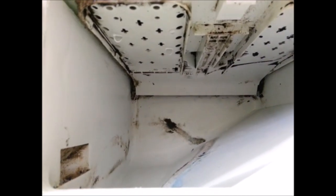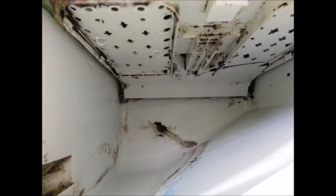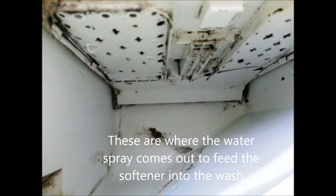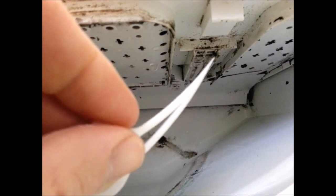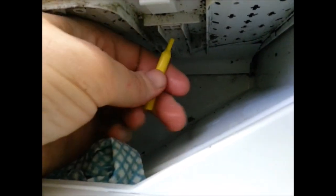I've taken the tray out and you can see there's black gunk everywhere, which is caused by putting too much softener in — it can go a bit mouldy. I need to clean that tray, but the main problem area is these four holes in the middle up here. That's where the softener comes out. I'm using the flossing brush to clean them out — push it right in and get all the gunk out; you can see gunk coming out. I've taken the main debris out with the flossing brush and now I'm using the inter-dental brush to give it a good clean.